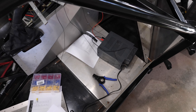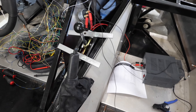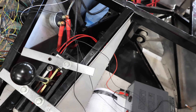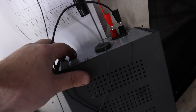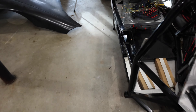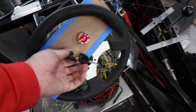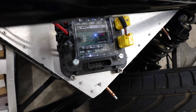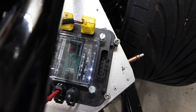In the spirit of getting this thing working, I actually have a small Radio Shack power supply down there — 12 volts — that I should be able to power the entire system with. Right now the battery is still not connected; I'm running it directly to the computer system off of the bus back there and grounding it into the system. We're going to turn this on and see what happens. Okay, we have power — that's some good news. Some lights up here. Ignition key up here. Everything should be off. Yep. Now turn the key on — there's the ignition light, so the ignition relay is on. And then the push-to-start — hold it down for three seconds. One, two, three.